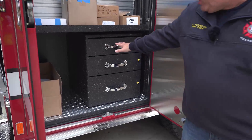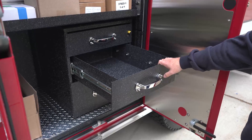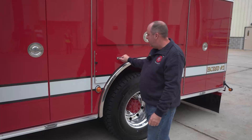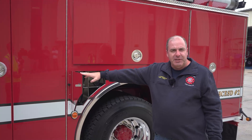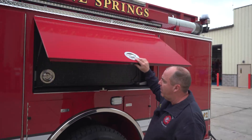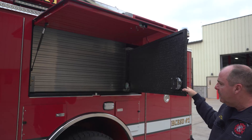This will be the first truck where we also have a built-in toolbox where we can decide if we're going to carry tools or put adapters in there — not 100% sure how we're going to lay it out yet. We have pack rack in all of our compartments and also beside the rear seats in the back of the cab. We took advantage of everywhere we could think of — they'll carry either extinguishers or extra SCBA bottles. Pierce does a very good job of taking advantage of any unused space and making sure it becomes useful. On our high-side compartment we went with a pegboard swing-out door so we can mount tools, with pack rack on the back side of it. Nice, simple, and clean.